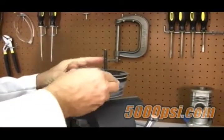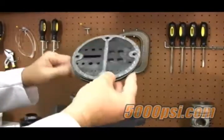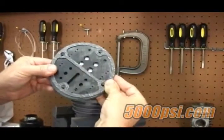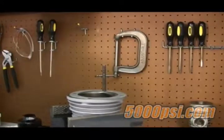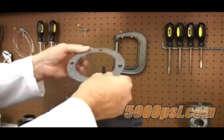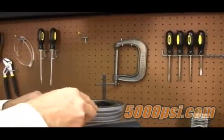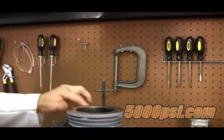Next we want to remove the old reed valve. Using the screwdriver, pry it free and then lift it off. The thin reeds in these valves develop undetectable fractures and seat wear over time — they cannot be rebuilt, so the reed valve assembly should be discarded. Remove the underside gasket from the cylinder ledge and, as before, scrape the cylinder surface with the razor blade and scotch-brite.